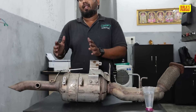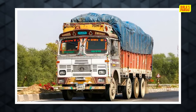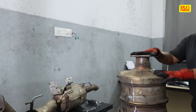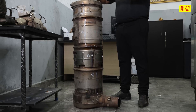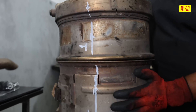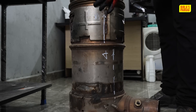In this model, DOC and DPF — there are two portions. But if you look at trucks or cargo vehicles, it's DPF, DOC, and SCR — three portions. In total, one exhaust unit. In this case there are four units. This is a high unit. Here is the DPF, this is a urea filter, this is SCR, and this is a unit for the service. This is a full choke — full of urea and carbon.